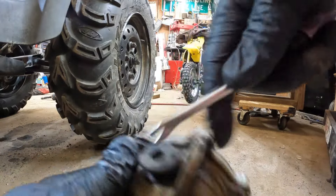You're not getting nothing — you actually get some noise off the injector, and you can also hear the fuel pump relay clicking back here, so more than likely the pump is the problem. You're just not getting any fuel pressure; this thing will just turn over and over and will not start. So what we're going to do first is pull this pump off.